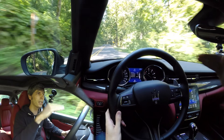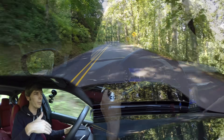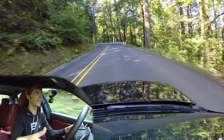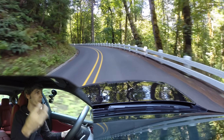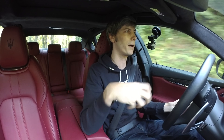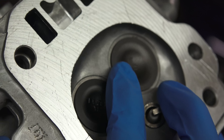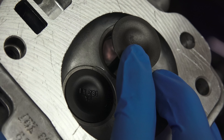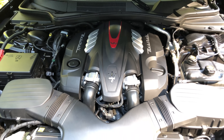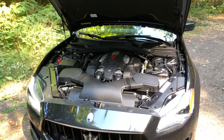The peak of deposit formation is around 200 degrees Celsius. Below about 190 degrees Celsius it's too cold — the precursors don't actually react with the metal. Above about 290 degrees it's too hot for those molecules; they don't want to bond. They either break apart and go out the exhaust, or it's simply too hot for that molecule to bond with the metal. So that 190–290°C sweet spot is where you really don't want engine components to be, from a deposit standpoint.